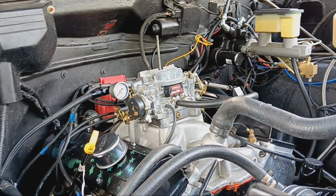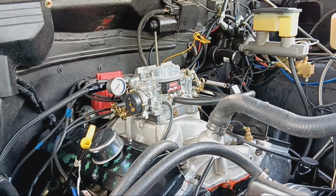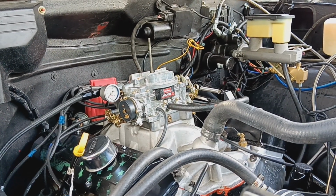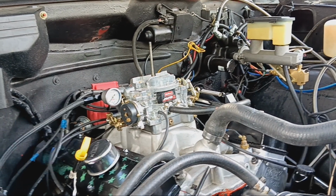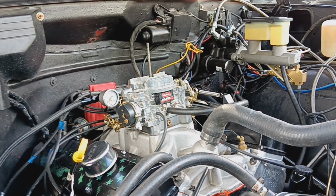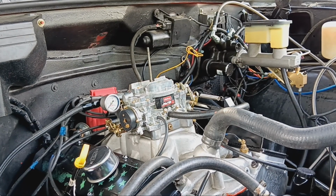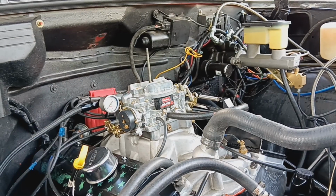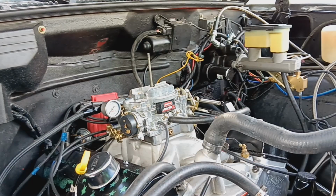But yeah, man, I can fire this thing up and it is completely quiet. This engine is known for messing with the valves, and the rockers would shut up for a little bit, and then you'd start it up the next day and it would make noise. Well, that was those stock slot rockers hitting. You'd back them off and give them like a quarter turn of lash, and they'd kind of shut up for a minute, and then you'd creep up on it a little more. So you give them a half a turn and they start making noise. Three quarters of a turn, they make more noise.